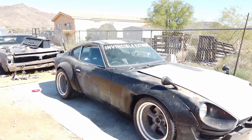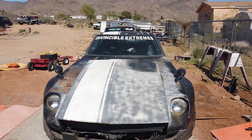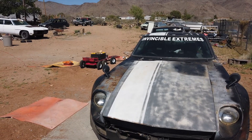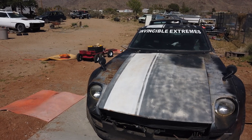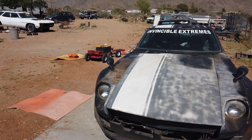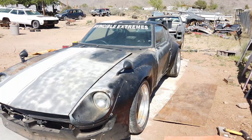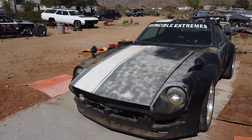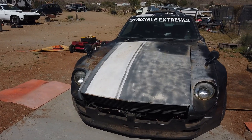I'm using it for better geometry for now, but smooth hydraulic power steering would be nice. I'm not a big fan of electric power steering — if it shorts out it's stronger than you and can turn the car wherever it wants, though that's pretty rare. The other reason is the factory rack doesn't work as well with these Mustang spindles as the Subaru rack does — the Subaru rack is a little wider, and with the Ackermann angles of the steering arms the Subaru rack works out perfectly. You get less bump steer — practically eliminated — and more steering angle. Dustin's car has so much angle he hit the frame rails, but he's running factory track width, not the two-inch wider setup like me. The trick is finding the right combo of inner and outer tie rods, and the outers are 14mm, which is kind of an industry standard lately.